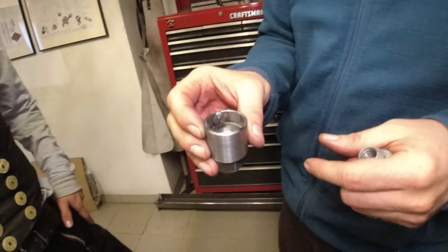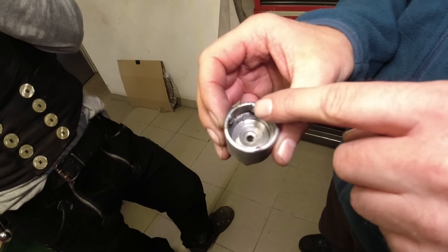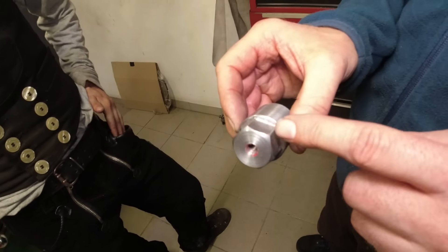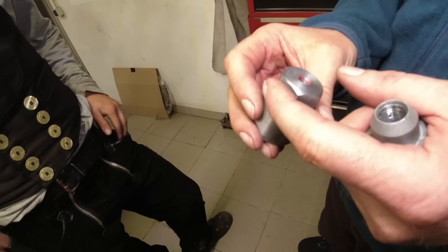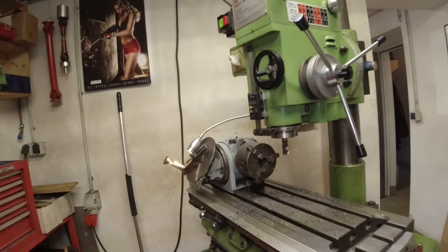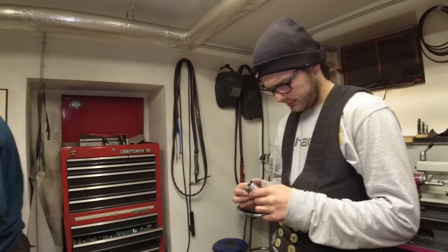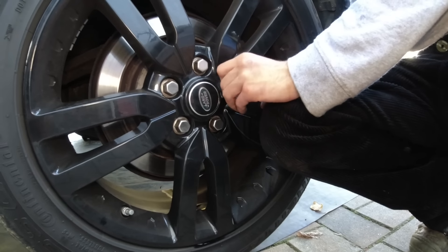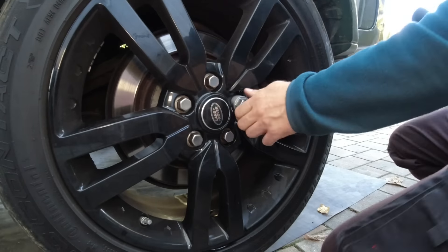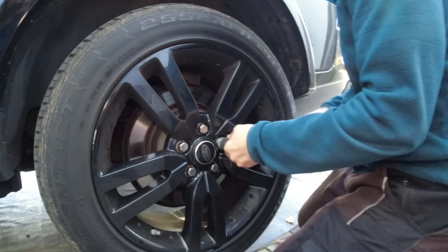We transferred the welding spots with our molding. Robin machined the inside to dimension, the outside to dimension, and added the hex head using an index head from my 83-year-old dad. Now we're going to try if it fits on the wheel nuts on the Discovery. It fits — only in one position. I'm going to do the torquing myself because I don't want to give Robin the responsibility.